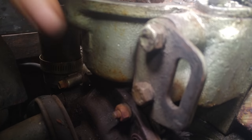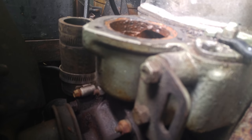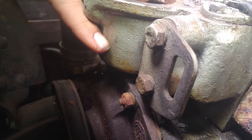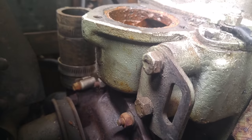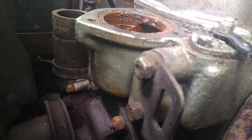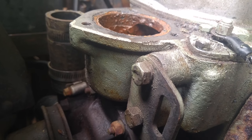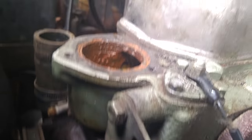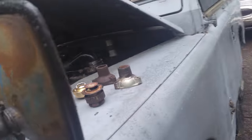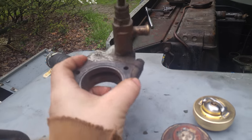As you can see, being a Series 2, it's got the deep bottom on the cylinder head right beneath the thermostat. The later Series have a really angled one. I'll insert a picture of my spare engine, which I got the other thermostat housing top off of. The thermostat housing itself — I've got it off here — it's got the bypass pipe on it as well. It has this ridge around here which seats the thermostat.